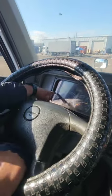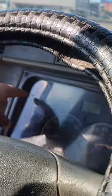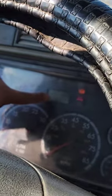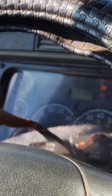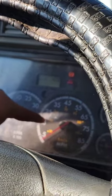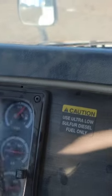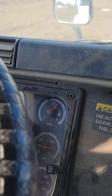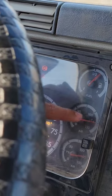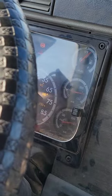Now I'm going to identify my gauges. I have my oil pressure gauge — must be 30 to 60 psi. My water temperature gauge — no more than 200 degrees Fahrenheit. My voltmeter — 12 to 14 volts. My tachometer — no more than 1500 RPM while operating this vehicle. My speedometer — I must obey all speeding laws. My fuel gauge is 95% full; I leave room for fuel expansion. My DEF meter is filled to operating levels. My primary and secondary air gauges build maximum pressure between 120 and 140 psi.